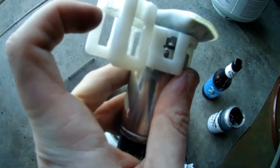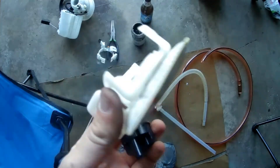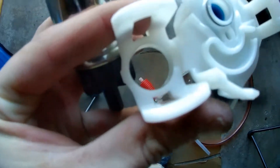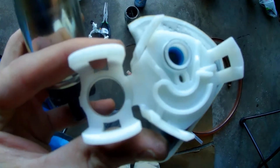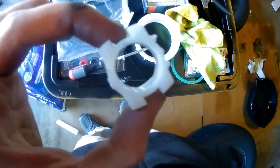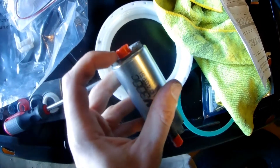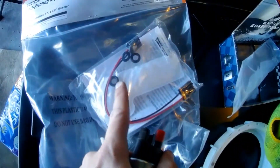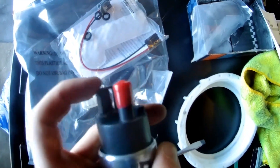These are the two important ones. Now we can pull the fuel pump off of this little thing right here, and we are going to cut at that little gap right there — cut that three-part section off from that tube. We clean cut it, and this is the piece we keep — that goes back onto the fuel harness. Here's the pump. We've got to remove the cap here and here, and then we put the stack of O-rings onto this, and then we'll put it back together.